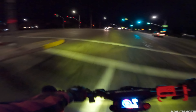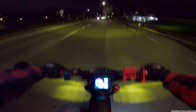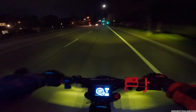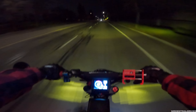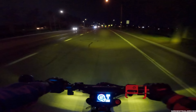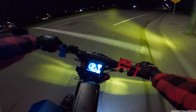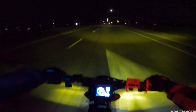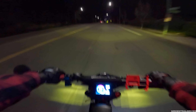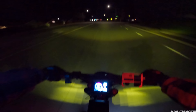Leaving work we were at 80.7 volts. Under full throttle we have a voltage sag of about 73 volts, and when I let off we go back up to about 79.5. I'm feeling a bit skeptical about the range unless we just lose that first 10-20% really fast. The ANT BMS showed cells going down — at about 4.087 volts per cell. There's also a flip switch on the side of this battery and I'm honestly not sure if it works.